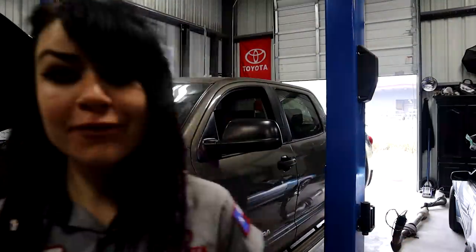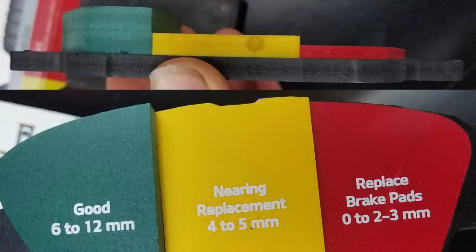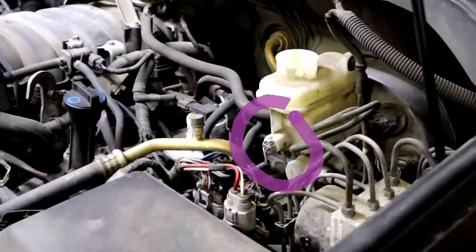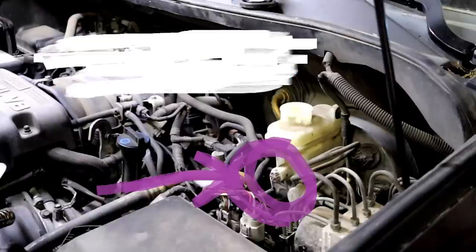Let's get this open. The first thing I'm gonna do is scope out the level of the brake fluid. On Toyotas, you never really want to adjust the level of the brake fluid. The fluid level actually reflects the brake pad level — your brakes are brand new, your fluid level is completely full, and as you wear the pads down, that fluid level will go down, because it makes up for the space in the calipers. On your reservoir is a brake light switch that illuminates the brake light on your dash when the level's low — that's Toyota's way of alerting the driver that you're gonna need brakes soon. I think that's really cool.